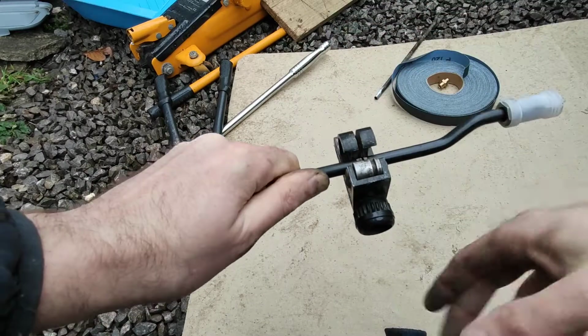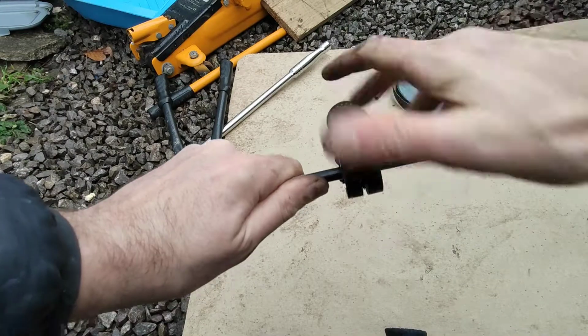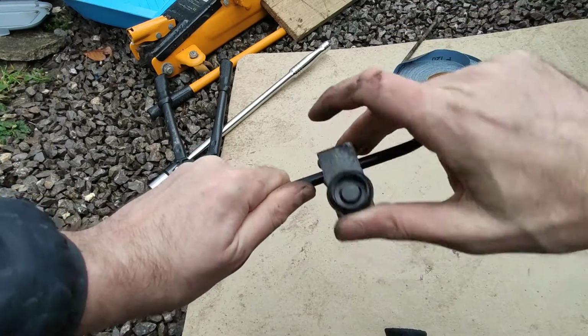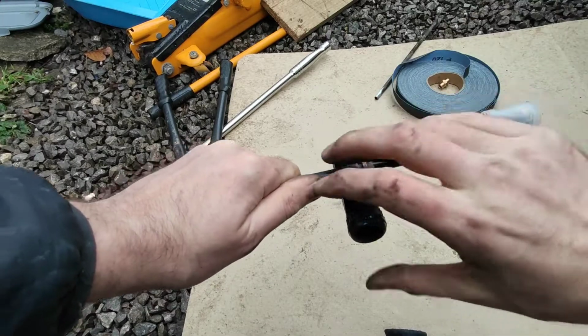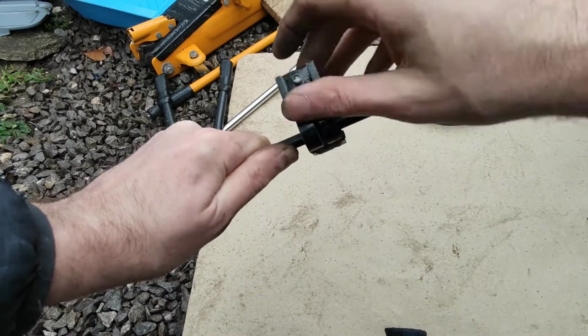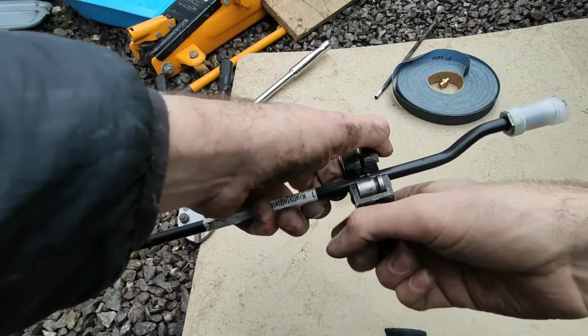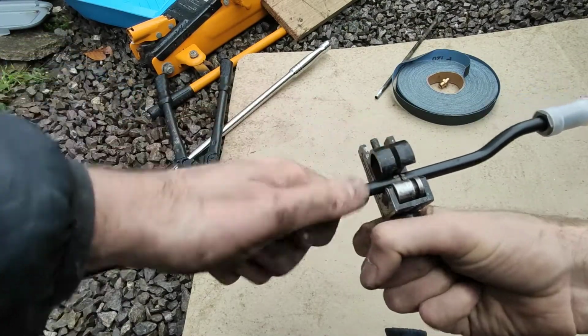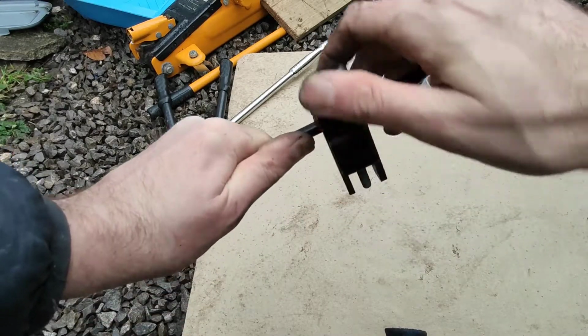The kind of compressed bit you get when you cut a pipe like this, in a high flow system like a water tube, can cause cavitation behind the joint, but I think we'll be alright with this fuel line, especially with it being steel. I suppose it's more of an issue with a softer metal like copper.